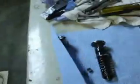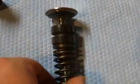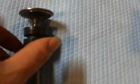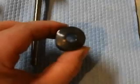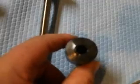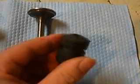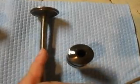But I just wanted to go over something. The guy that I have do all my machine work, he's really particular, which is good. He's been noticing problems with the replacement parts of today that are made in Taiwan and such. And one thing that had to be done is this hole in the valve guide. I don't remember the exact numbers offhand, but there is a clearance in which that valve can ride up and down in there. The way they come, it is way too tight, especially for the exhaust valves,